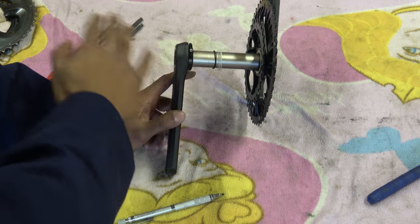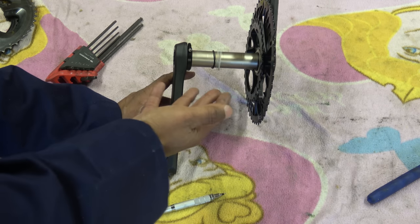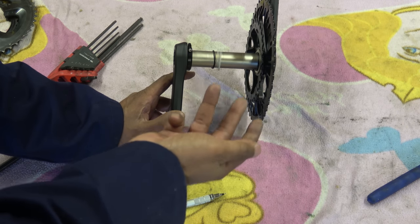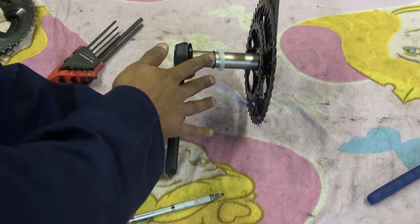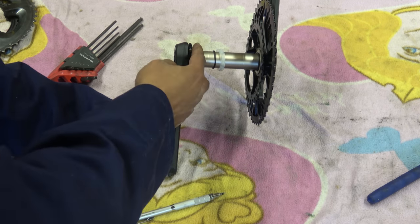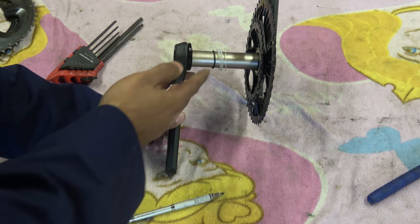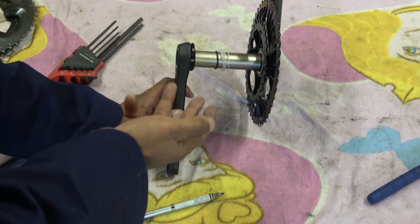The advantageous thing with this is that it's going to fit any bike. You're not limited by small bearing sizes or trying to fit a 30mm or DUB axle inside a BB86 bike. It's 24 millimeters — a fairly standard size. Because it's 24mm, you're not going to trash this axle easily; you've got Delrin spacers if you choose to protect you. Whereas on a 30mm, it's directly onto the bearing surface.